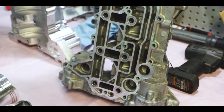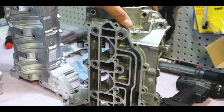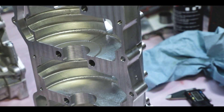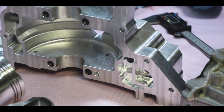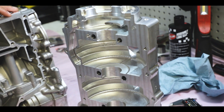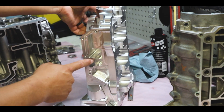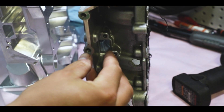We've done some things to try to strengthen that up. The next step to add a lot of strength and structure to the block was to go to a billet girdle. Now we're fully tied mains. This can accept a 10 millimeter main stud, so if a block has had issues with the threads we can go up in size. My current engine is running a 10 millimeter main and 11 millimeter head stud. We also integrated the oil pickup — factory there are some bosses and you slide in a plastic piece that's kind of sealed in there.